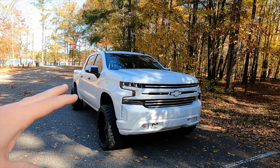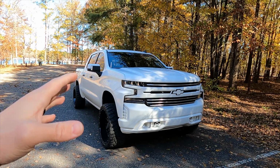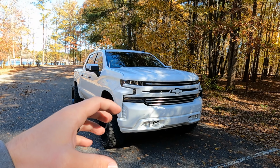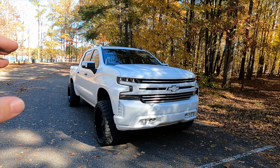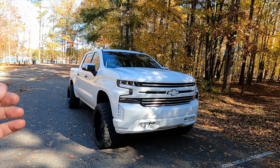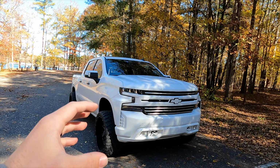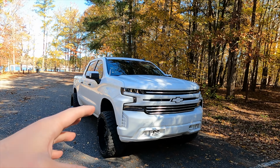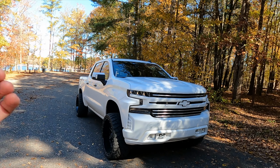And that, I think, is why they say don't use four-wheel auto once you have this kit, because it's shocking the system. It's going from two-wheel, and then boom, everything hits the front four-wheel drive system. It's locking in. That's where you're going to have issues. That's where you're going to snap an axle or possibly bend a tie rod, because you could think about it, from having no power to it and then just the shock of that engaging while you're driving. Like, you could be spinning a lot of RPMs and then it senses that, boom, hits it.